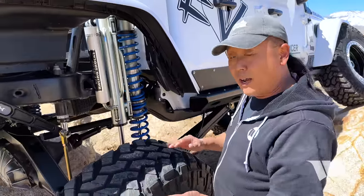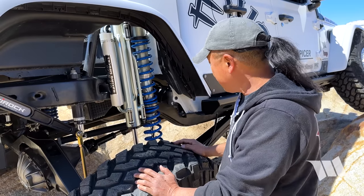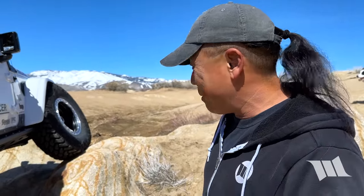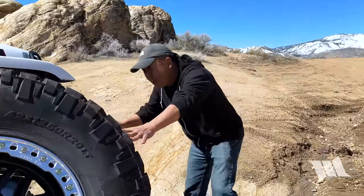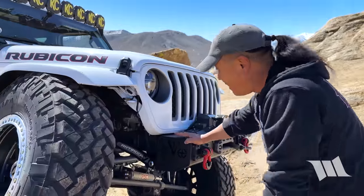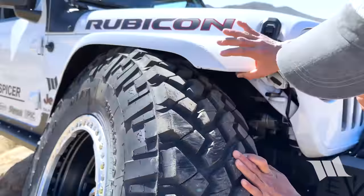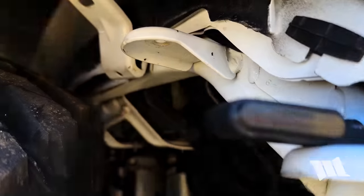At bare minimum, we're going to have to try to center our axle a little bit more, because we weren't seeing rubbing before — or we may have to install wheel spacers, maybe even a combination of both. But otherwise, I think that's as twisted up as you're going to see it — maybe the most impressive flex I've seen on any of the Jeeps we've owned. Up front, totally crossed up, driver's side tire just barely touching the ground, and yet the air bump is not even making contact with the axle. There's still plenty of resistance keeping our tires from touching our fenders — they're totally clearing everything now.